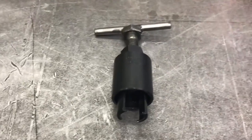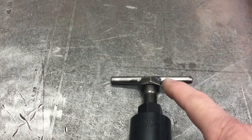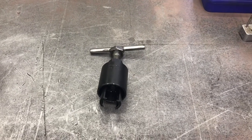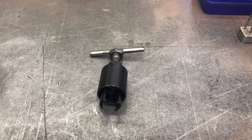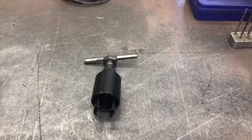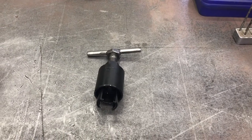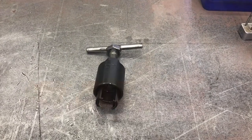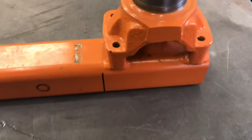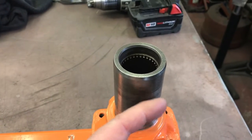Nice-to-have but not required is the Kent Moore J-tool that picks up the entire lower unit — it pops over the shaft and you slide the collar down, with a grab handle I made for it. That way I can lift the lower unit in and out vertically. If you don't have this, simply lay the case horizontally, swaddle the entire lower unit like a baby, and pass it through with the center support bolt hole facing out — valve body up, case horizontal — until you can grab the output shaft sticking out through the case and guide it home. I also made a rig to stack up the lower unit with a plug to hold the output shaft, and it lets me check that my tail housing bushing is the correct size.